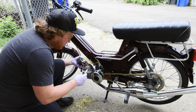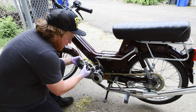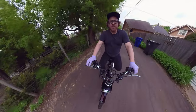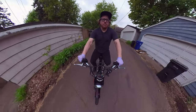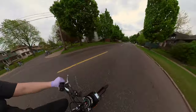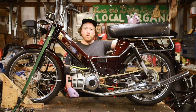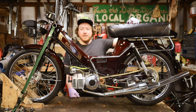Installing an 83 — this will lean out the top end a little and it shouldn't bog anymore, it should go a little bit faster. After I got back from that ride it was running great. The jetting now is 83 main jet and a 43 idle, and I think that's as good as it's going to get.